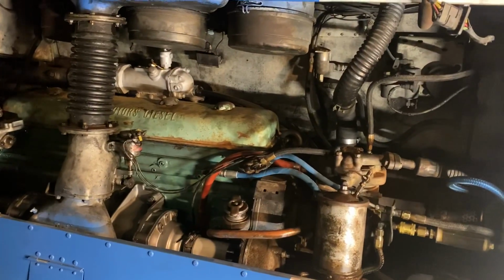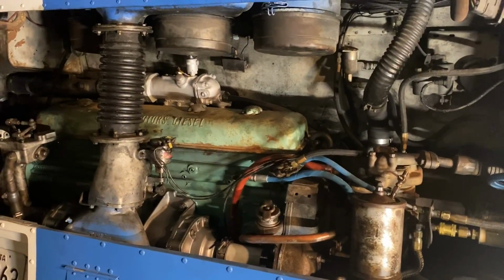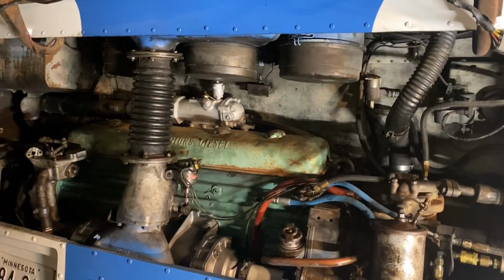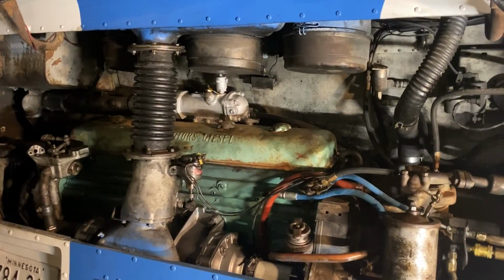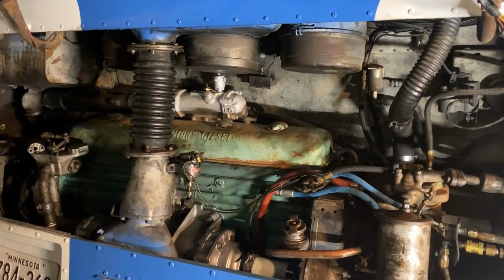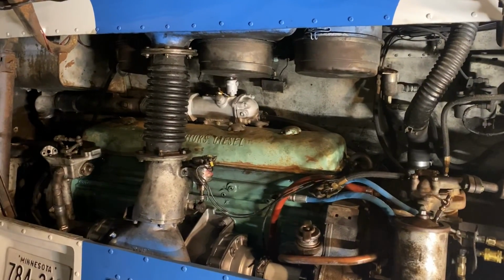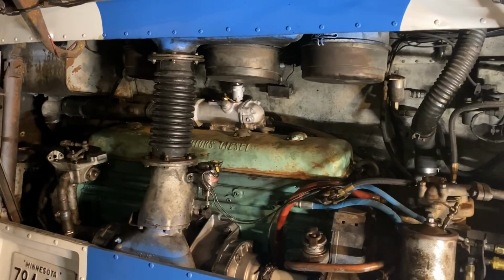But it's not one, you know, we shorted each and every cylinder. It's not just one, so it'd be multiple. There's no way that I broke multiple rings going in. There's just no way. They all went in just fine. So I really think it is the injectors. They're sometimes working, sometimes not working. To have a cylinder miss and then not miss and then miss again, I really think that that's what we're looking at. But I've never put new rings and new liners in something and had it smoke afterwards, especially with the new blower. So I'm very surprised by that.